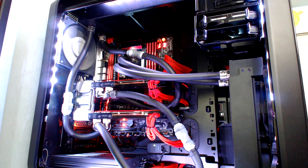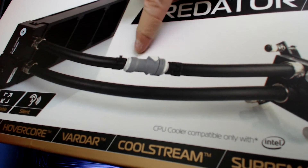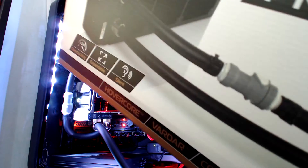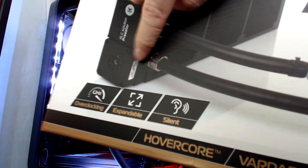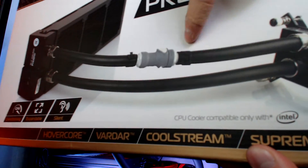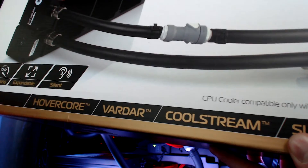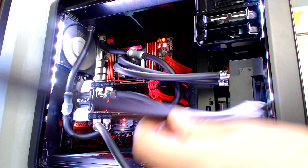Let me go over it one more time using the box. Think of my radiator mounted up like this — the far end is where the pump is, that's the outlet. I took the male piece and put it on that outlet, and left the female piece on the inlet. That's exactly how I did it, and then this is the tubing I saved from the swap.